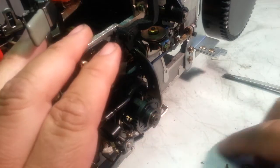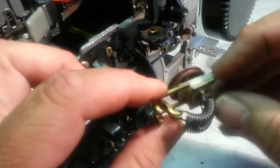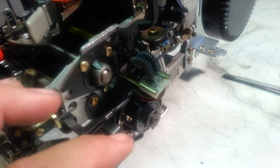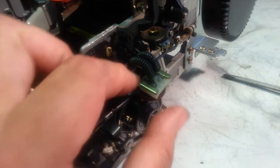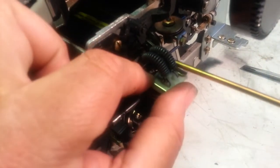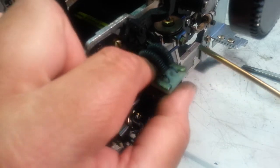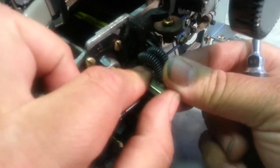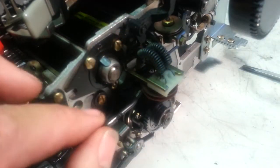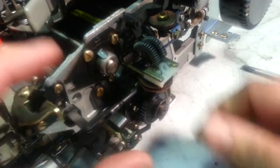This machine is in such excellent shape, I'm going to put in an original IBM part with a nice metal bracket here. Let's put this in here. Just kind of center this bracket up — it's got a little detent spot here if it's in just snugly right there. Tighten that, make sure this link is not interfering with anything, and tighten that screw tight because it's the only one holding that on. There we go, new bracket.